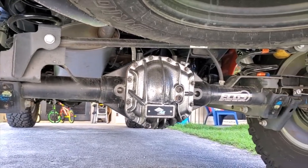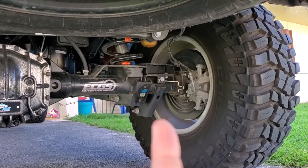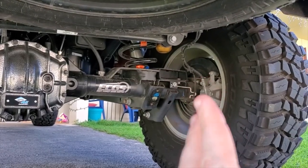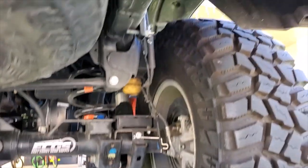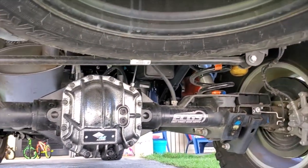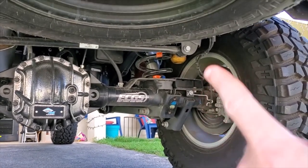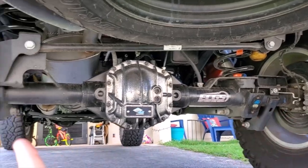Now that the Jeep's off the lift, I wanted to cover a few things I forgot to mention at the shop. I did remove the sway bar on the rear — it comes down with two long sway bar links and sits vertical back here. If this slips off a rock or there's not enough movement built into the sway bar links, they will break the metal bracket where you can see the bolt sticking through. I just replaced the bolt and left the bracket on. That's why I pulled it — to get access to the diff cover. Also when going off road, the rear sway bar sits so low that if it slips off a rock, it will destroy that whole section.